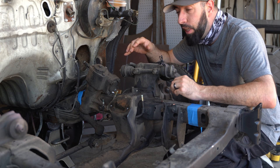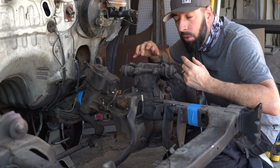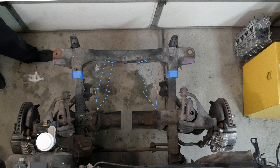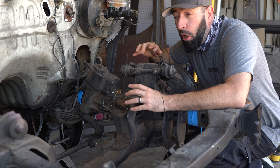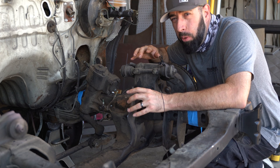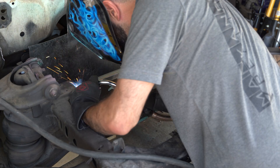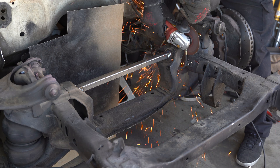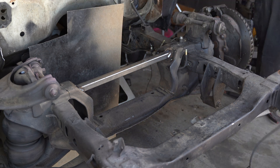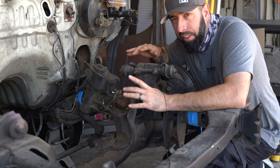All right, I'm about to cut into the frame, but there are a couple of things I need to address first. When the frame moves in, the motor mounts move as well, but the motor is going to stay the same width. So I'm going to weld the motor mounts together with a bar in between and remove them as one unit. When I'm finished with the frame, I can refit the motor mounts and they will be the exact width and angle that they always were.